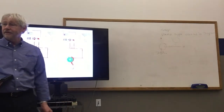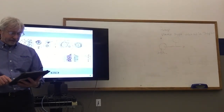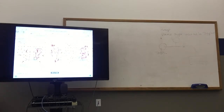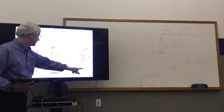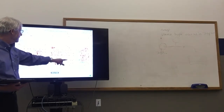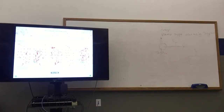You could find it in SI — in the glossary. Those pages way in the back of the book will show you where all those orifices are. You've got to be patient to find orifice number 4. It's in the spacer plate, and it's going to tell you here — this is the control valve body channel plate, control valve body spacer plate. So you want to identify which spacer plate it's in, then search through to find orifice number 4. Because if orifice number 4 is plugged, how is that going to affect things?